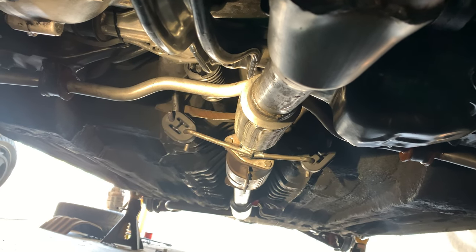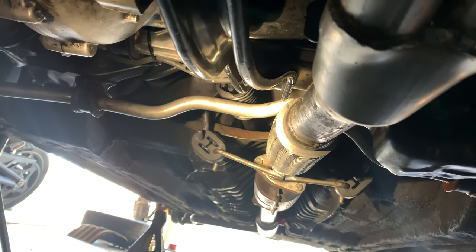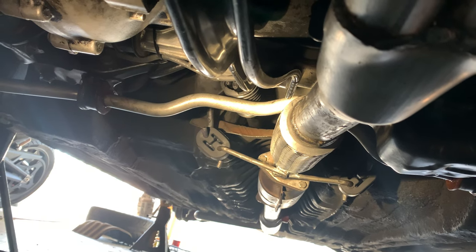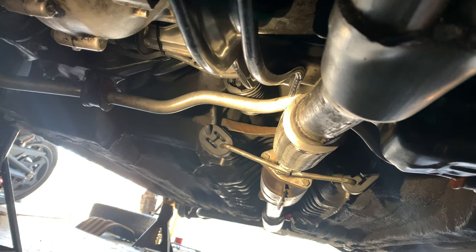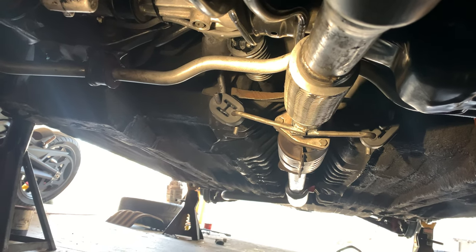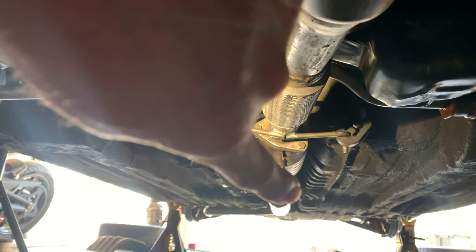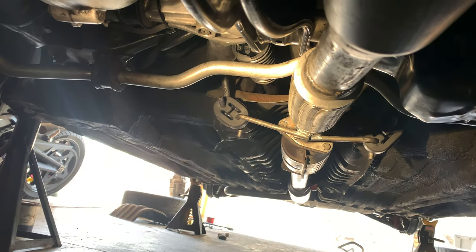It's not that I was having a major problem with the sound, just that I could tell I had an exhaust leak. And you see the hangers, I used stock replacement rubber there, because there was just no way I was going to get those polyurethane on there. But I did use a polyurethane to hang the mid pipe just before the exhaust collector, way down at the end there. You see right about there, there's the red exhaust hanger.